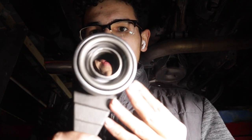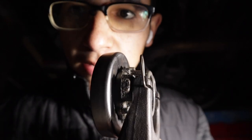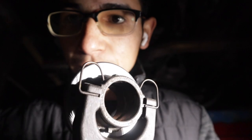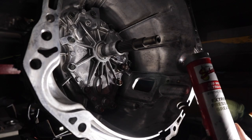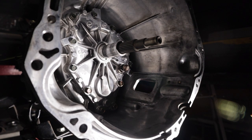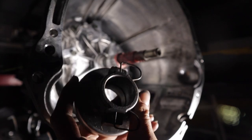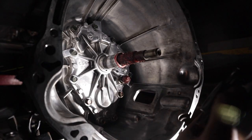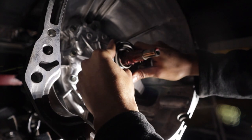I got the new bearing pressed in, looking nice and sharp, with the spring and everything connected to the fork. It's pretty simple — just put it back together the way you took it apart. You've got a clip going up on the fork and it connects to this piece on the shaft. I'm going to use Schaeffer's 229 Moly Ultra Red synthetic blend grease — this stuff is amazing. Just put it around that area and inside there because it's going to be sliding back and forth on the shaft, so you want it lubed up. Pop it in place, push it hard — there it is, locked in. All this is brand new.